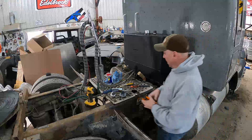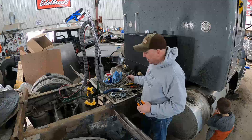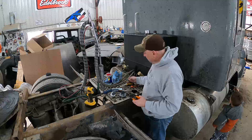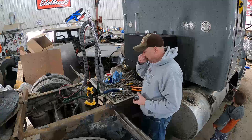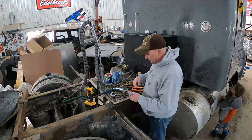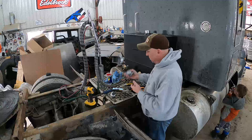This is actually automotive seven-way wire — it's not like semi seven-way wire — so it's actually missing a black wire. In its place there's a purple wire, so what I'm gonna do is just make the purple wire the black wire. I'm gonna wire the plug in order as you normally would a trailer plug, but I'm gonna make sure I mark this so we don't end up plugging a trailer into it.